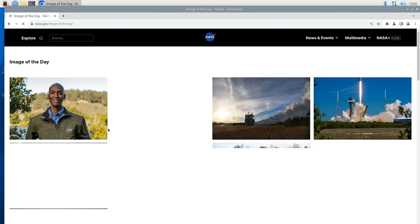On the BrowserBench.org Speedometer benchmark test we got a score of 64.6 on the Pi 5, which is considerably better than what we saw out of the Pi 4 back in 2019. The Pi 5 is much faster with its new processor. However, looking at the chart, the Intel N100 in a Lenovo Chromebook and the N95 in a small Windows mini PC do considerably better when it comes to web browsing.